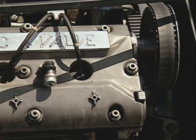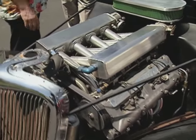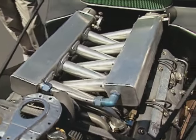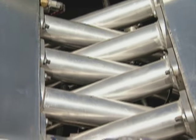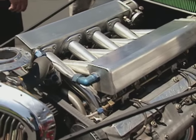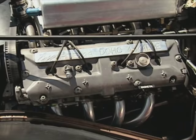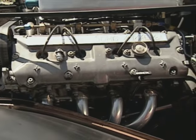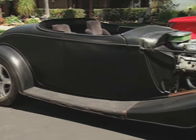Simple. Unbelievable. Now that's got to be easier than a lot of your other projects in the past. Yeah, well, I've done a few belt drives on the other engines, the overhead cam engine, so it's fairly easy. That's great. Got a 427 crank in it, Scat rods, and Chevy pistons. It's an aluminum block? Yes, it's all aluminum. The head's, block, everything's aluminum. It looks really mean. What kind of power does this baby put out? It makes 550 pounds of torque at 2,500 and about 500 horsepower.